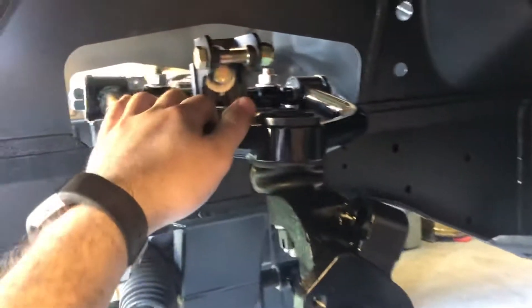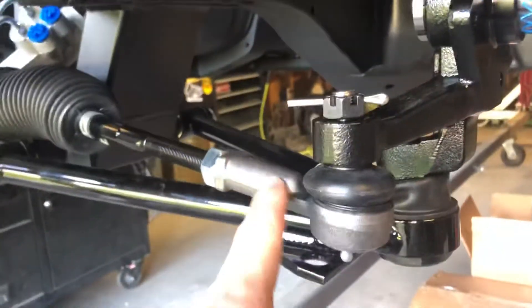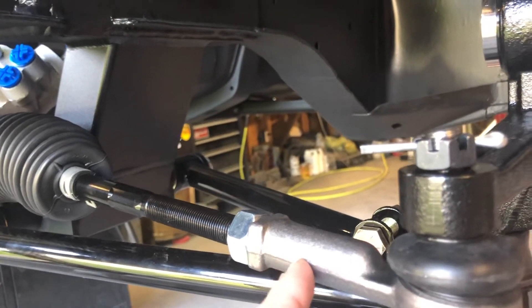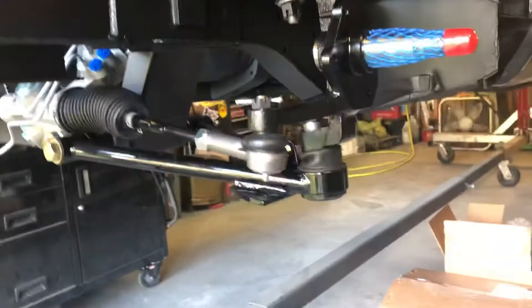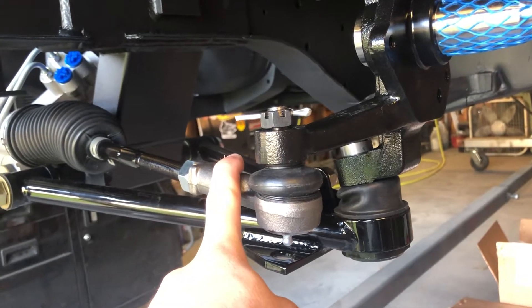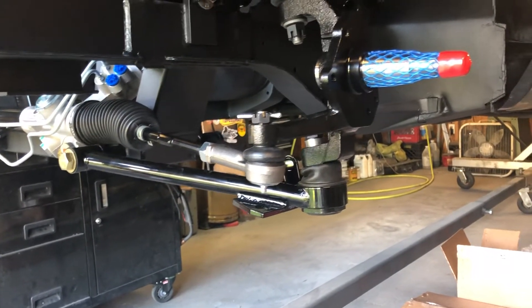The rear kit fits the top but not the bottom — it's inch-and-a-half with the bushing they have. So I think I'm going to end up having to get longer rod ends because these only thread in about half an inch. I don't feel comfortable with that — I like them threading in a good inch to inch-and-a-half normally. The short ones are like $10 but the long ones are like $40 a piece, which is ridiculous, though I'm sure I can find them cheaper elsewhere.